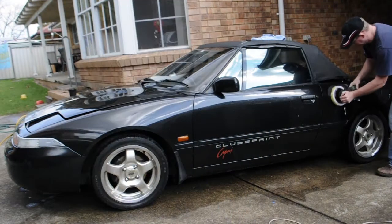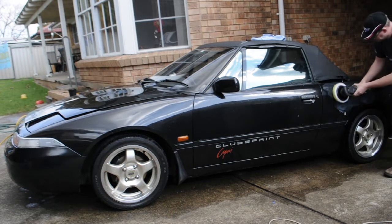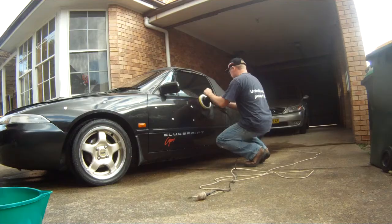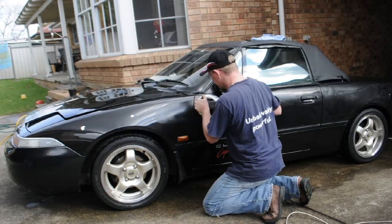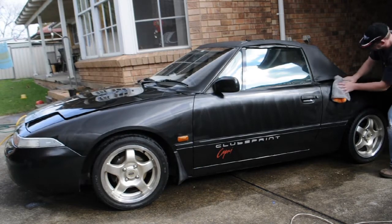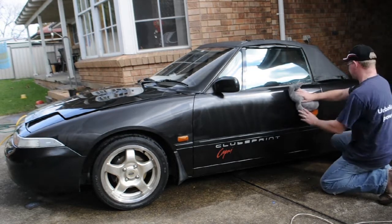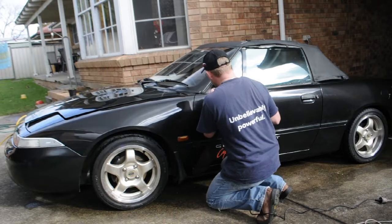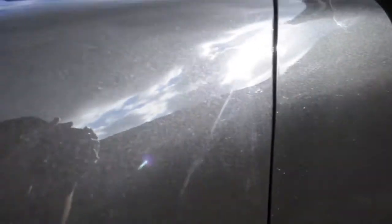Now it's time to use a buffer. We're using the buffer just to get the final part off, just to get that really deep cut and actually cut into the paint a little bit, so that if there is anything sitting on top we can actually get rid of that once and for all. Now using a microfiber cloth, we wipe back anything that's left over from using our buffer, anything we've used from cutting the car back, and what you will see is something that looks really, really quite clean. We missed a spot — go over anything, make sure it is absolutely 100%, and it should look just like this.